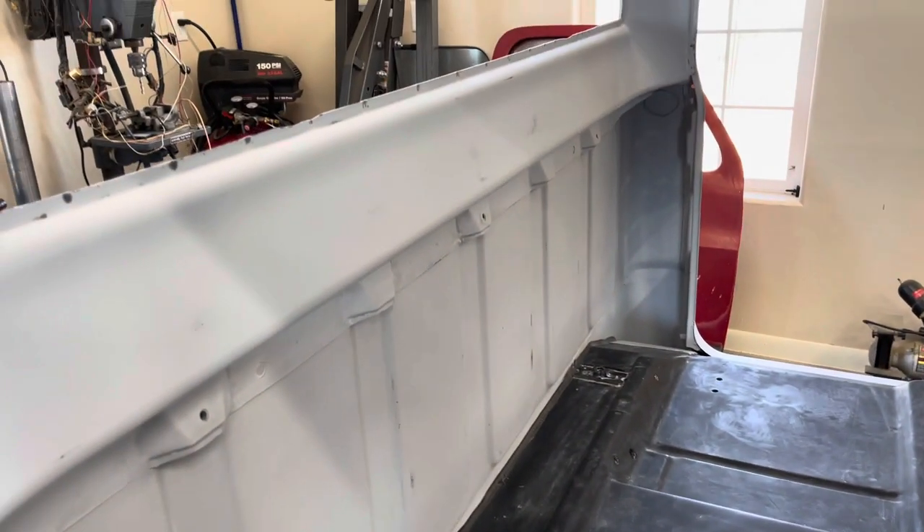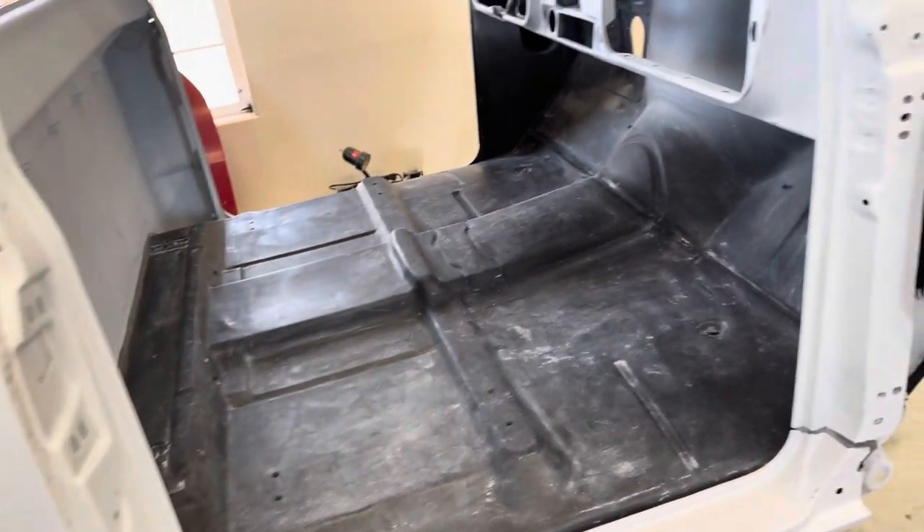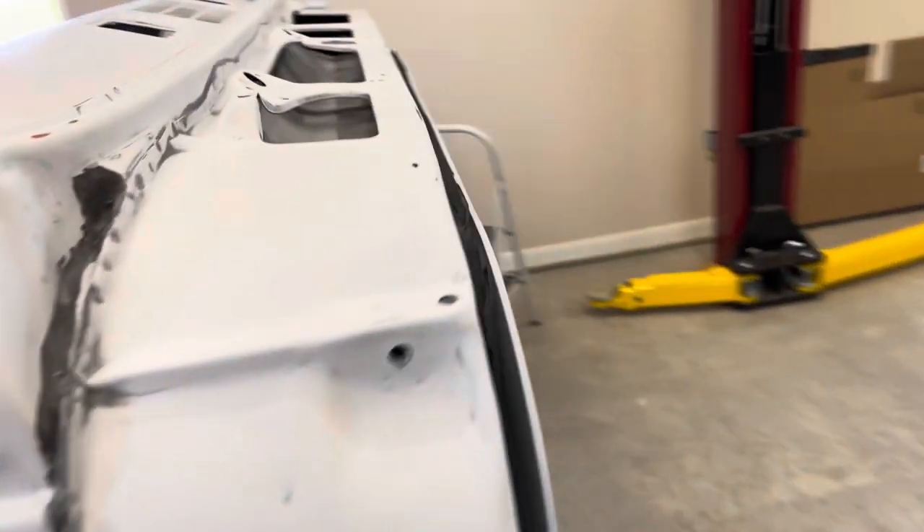This is going to be my seam right here. Your paint line will never be seen because it will be hidden behind the weatherstripping on the door jams and the windows front and rear. So I'm going to mask from here down and out on the whole thing, get the outside protected with some masking tape and plastic. I'm going to go ahead and start masking this up for the inside spray and come back after that's done.